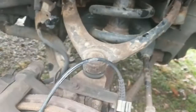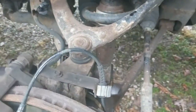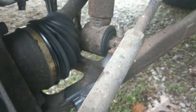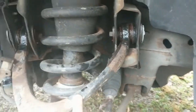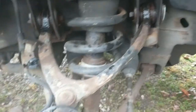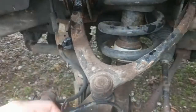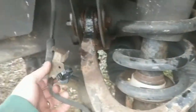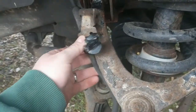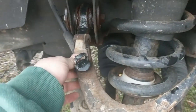The other thing I can do right now is put a jack underneath the lower control arm and lift it up a smidge to ride height, because when I put this all back together I need to set this control arm at ride height — once it's at ride height it'll stay there. Also, this sensor had to be unhooked from up here and this piece comes off over here. I did break a bolt at one time, so it actually just sits on with a couple zip ties, which have held up for the past three years.